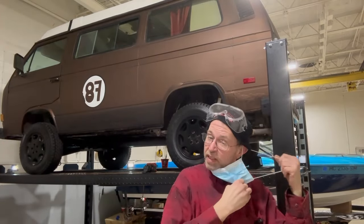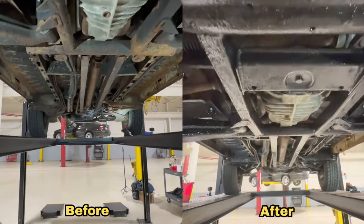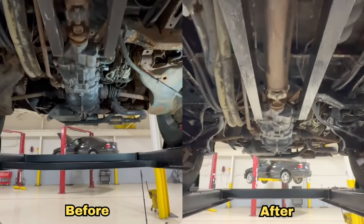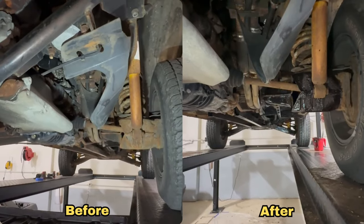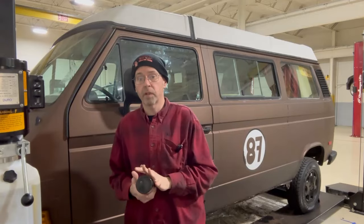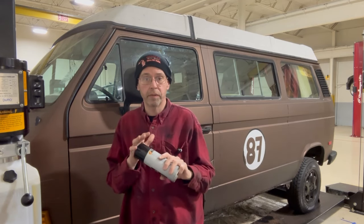Big brown van is big brown done. Let me give you a little overview. It looks like Dustin and I used about a half gallon of Fluid Film to undercoat the whole thing. I'm pretty sure if you weren't using a brush and were spraying it, you'd probably get four cars out of a gallon — rough estimate. Definitely would go smoother spraying, but in an environment where you have a lot going on and can't afford overspray, the brushing is definitely the way to go. I'm going to leave them a full can of the spray so they can do any touch-up areas as it dries. Thank Fluid Film for providing the product — I don't have a code at this point, but if I do by the time the video goes up, I'll link it in the description.